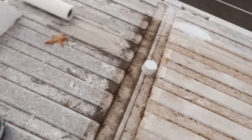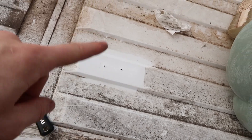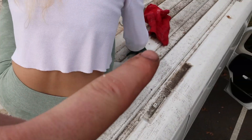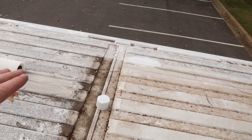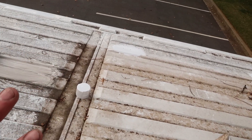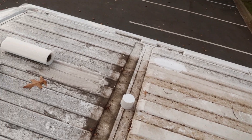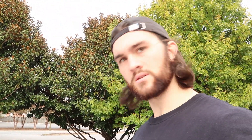Here's a better view of how dirty this roof is. We have the previous mount holes sanded and painted. Once it's all dried up we're going to get sealant in there and the sealant tape over it as well, just to make sure it's double sealed and not going to leak. Then the goal is to get this thing clean so we can get our DIY rack mounted and attach the solar panel to that.